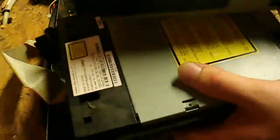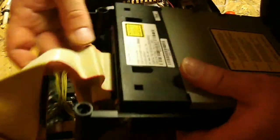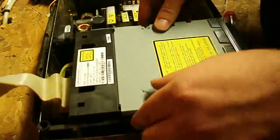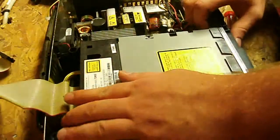I've got the other Thompson here - as you can see, I have two Thompsons. All we've got to do is - if you look, there's like a little black casing it's in, clipped on right here and the same place on the other side, right here. So you just kind of pull it outwards and down, and that pops out. All you do is put the new one and set it back down into place. Get it clipped in there like the other one was - just like that. Then you're going to connect the IDE cable again and connect the power cable. I called it a SATA cable already, but I don't think that's technically what it's supposed to be called. Then you just get it worked back in there.